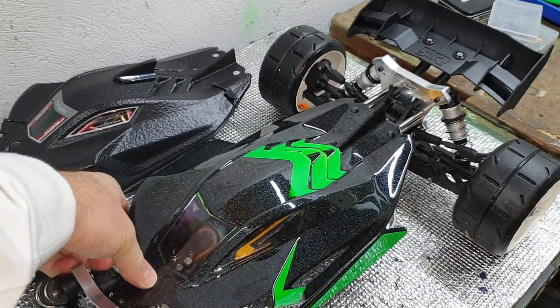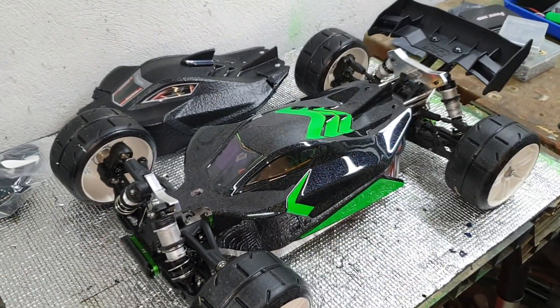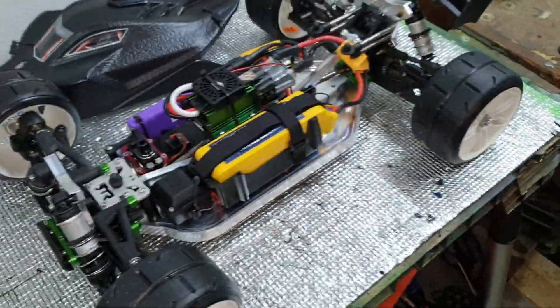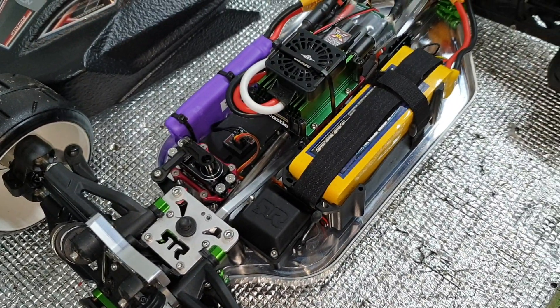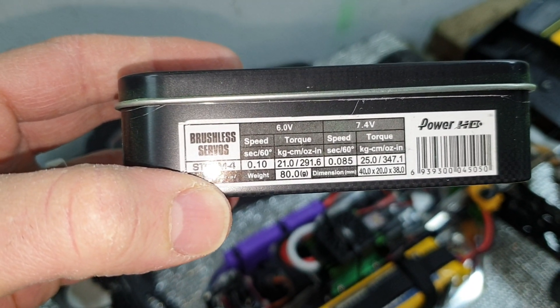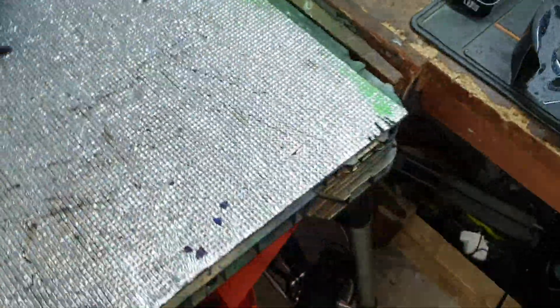Where I'm really pleased is underneath here. This is an 8S system. With the ESC I can go a lot further. That is the bad boy. We've got a high power servo in here — a pretty amazing servo running on 7.4 volts, very fast, 25 kilos. Storm 4. Pretty cool servo.